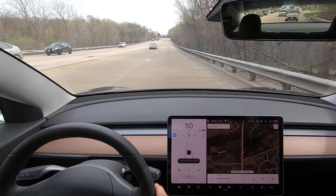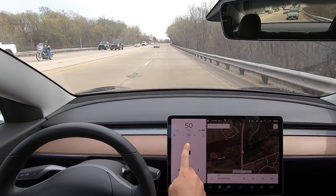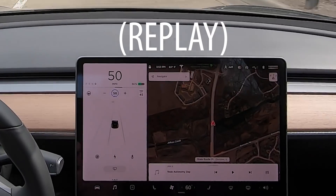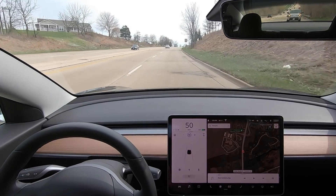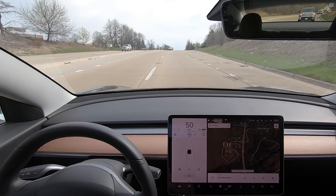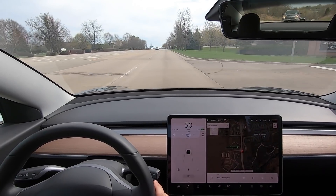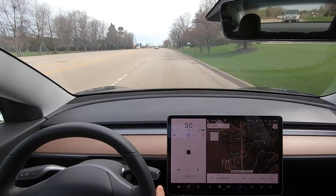In this first situation, I'm driving on autopilot and I shake the wheel a little bit to take autopilot off, but TACC remains on, and I let the car drift. You can see that the left red line is the lane that I'm departing and it makes an alert — it also re-centers the car in the lane automatically. If I drift again, it doesn't re-alert, so it alerts the first time you drift out of the lane and will re-center the car, but after that it doesn't seem to re-correct itself.